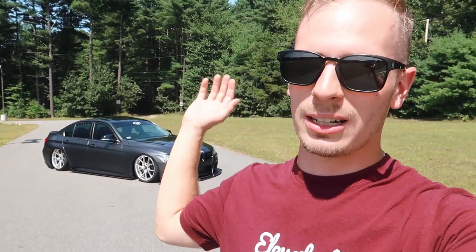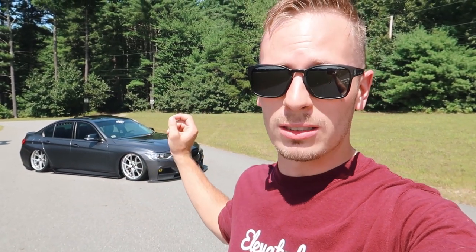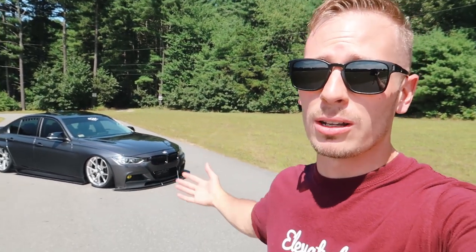You might be wondering how to check if you're within that 1% range. There are a lot of calculators out there — if you search 'wheel diameter difference calculator,' I use the one at fitmentindustries.com — huge shout out to those guys. They make it very easy: you just put in your tire size and it gives you your variance. I'm at a 0.83% variance in overall diameter, so I'm under that 1%, which is why I can happily say I've had absolutely no issues running this car with a staggered setup on xDrive.